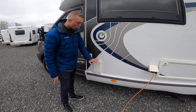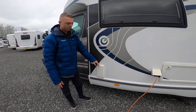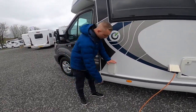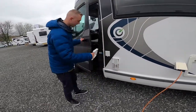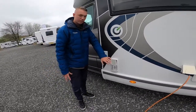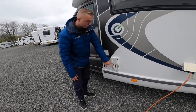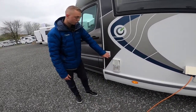This is your hot water system vent cover. When heating water on gas, this cover must come off; on electric it can stay on. When traveling and washing the vehicle, pop the cover back on — put your hand on the top, thumb in the middle, and peel it off. Best place for it is in the passenger door pocket. If you leave it on, you'll get a red light and you'll need to take it off so the excess gas build-up will be blown away.